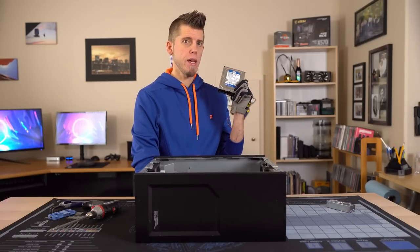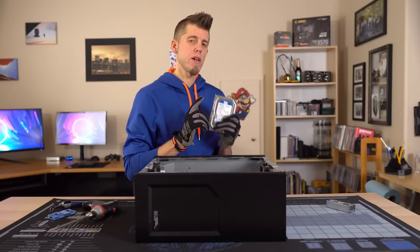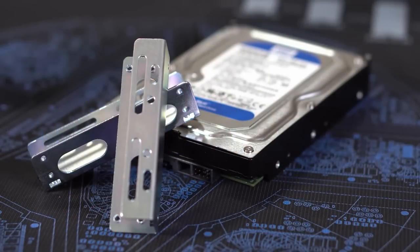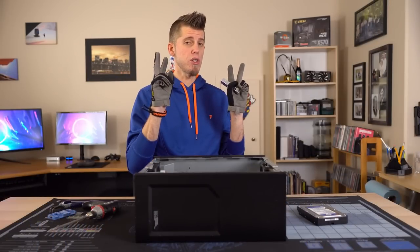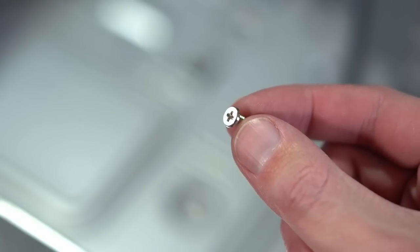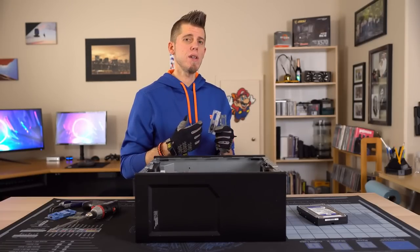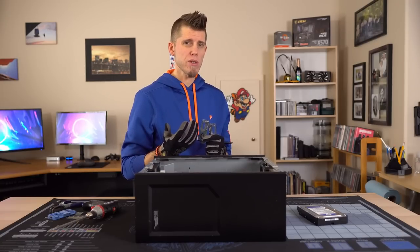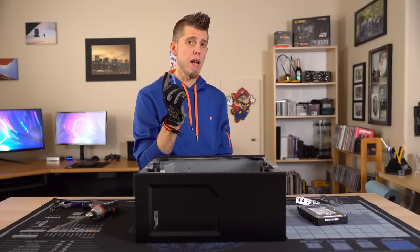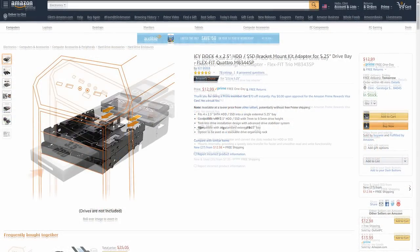Now I'm going to take care of the hard drive. I've seen people use the tabs removed in the fan mod video, and while that's perfectly fine, I just didn't like how that looked. So I installed it in the bay right below the optical drive. There are brackets you can use to adapt a 3.5 inch drive to a 5.25 inch bay using the spare screws from the front panel. But if you don't want to buy these brackets, you can just use some screws with a flat head. You'll still be able to install the latch and screw it on one side, and that'll hold the drive securely. There are also a number of other 5.25 inch bay solutions that could be more useful depending on what you're doing.